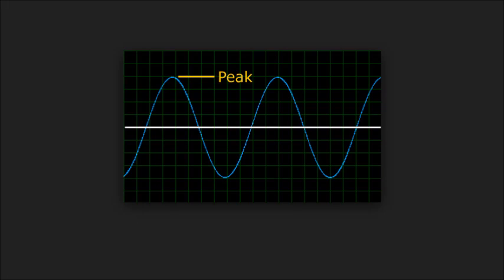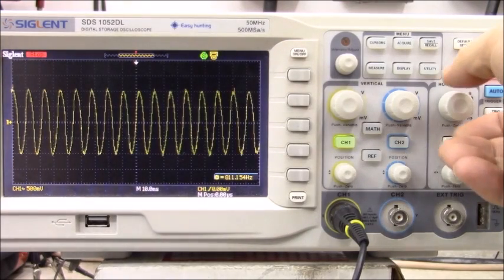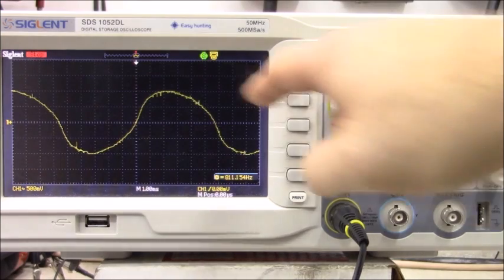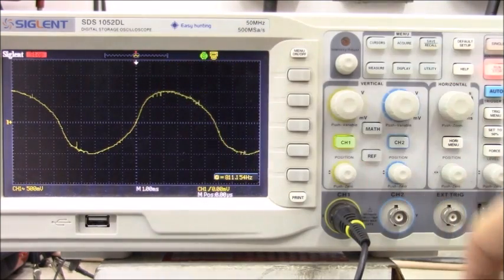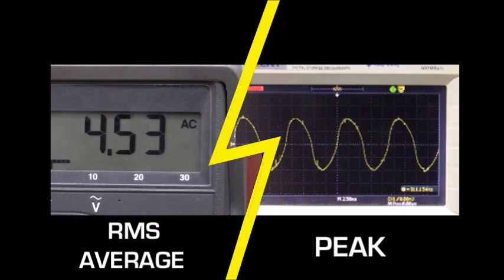Then along came someone who decided to measure their magneto output based on peak value. The peak value is the highest current the waveform will ever reach, and of course is always more than the average output. Clearly, comparing 12 amps peak to 4 amps RMS in this case is like comparing bananas and basketballs. The peak measurement method involves using an apparatus to read current directly on the scope. The peaks achieved by the mag can then be measured. The 10 volt peaks on the scope here equate to exactly 10 amps of peak primary current from this Super Mag 4. So the difference is average versus peak measurements.